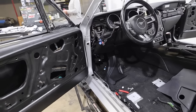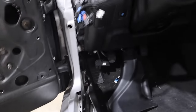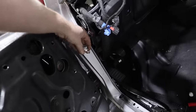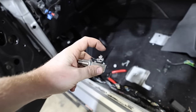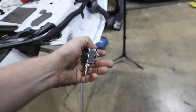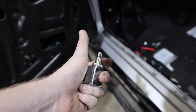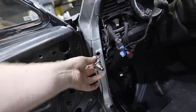After a little bit of learning about how to look at a plug — because plugs are mirrored depending on how you're looking at them front to back — we got it. We got our jumper in here, so you can see the car thinks the door is closed. There's no more door open warnings. Now, the next thing we do is put in a sensor to tell when the door is open or closed. This gets installed right here, and we wire the ground for the door harness. If you're doing this at home — the white wire in your door harness, pure white wire — black to the white. When this thing gets shut, it connects them, and when it's open it disconnects them. Shut also means door shut. So we'll go ahead and get this whole thing wired in and our car will know when the door is open and closed.